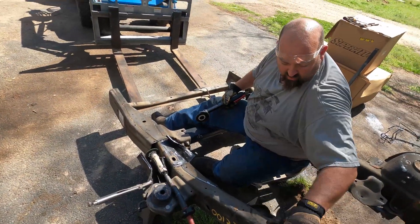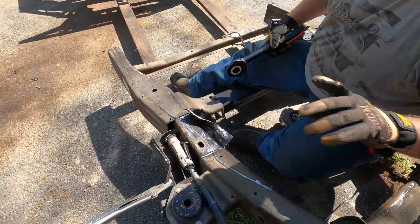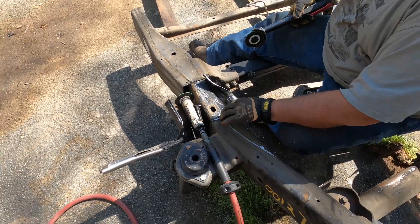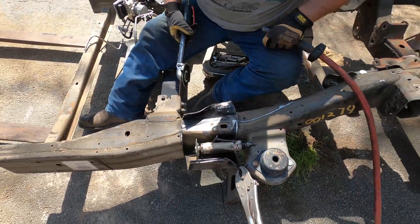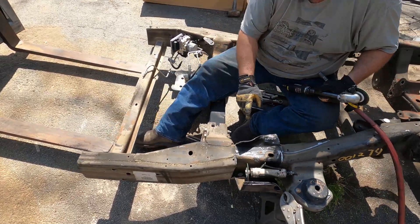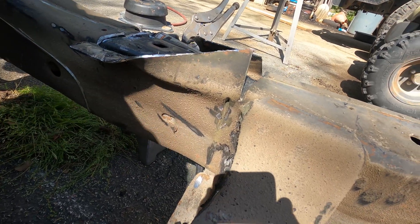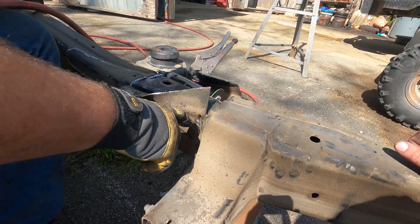All right, so this is the keeper front part. We're dissecting off the back section, which is the part that was on his vehicle that we had to keep. Now instead of being able to whack all the way through haphazardly, we have to be really careful not to damage what's underneath. There are two infamous welds on the back side — yesterday we could just grind as far as we wanted, but now we have to be careful not to destroy what's behind here. We'll cut it, try to peel it back, and grind a little at a time.